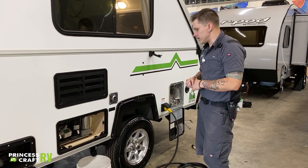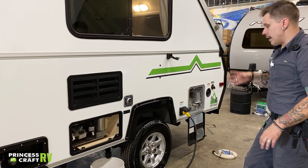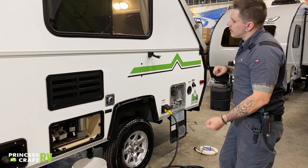Manufacturer further recommends that at the start of each trip thereon after that, we do go ahead and check and make sure they are maintaining that 100 foot-pounds of torque. So it is very important. You driving this unit home is going to be essentially the first time these tires have ever met the road, and it is, again, very important that we follow that torque procedure.